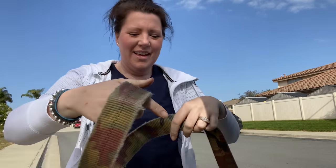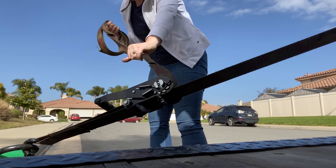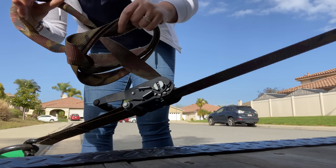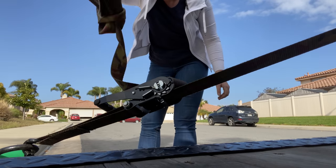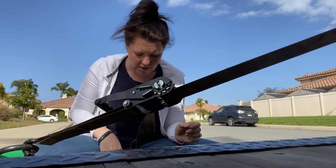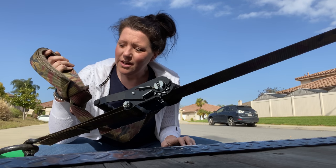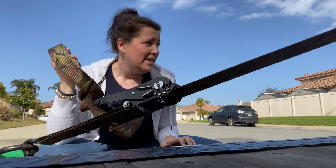It's pretty simple. Grab your strap and make circles — just keep making them. When you get to about here, take this end and thread it through the middle, then thread it through again and pull. There we have it — a nifty little trick. It's supposed to sit a little closer so it doesn't hang off, but even if it hangs off it's not going to hit the ground. And believe it or not, this does not come undone. That was definitely one of the niftiest tricks I've learned when strapping your Jeep down on the trailer. Let me just quickly do the other side.